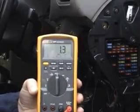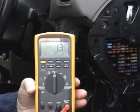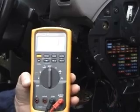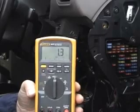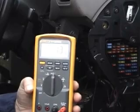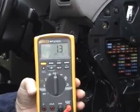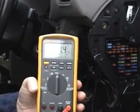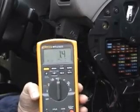Most probable causes for that would be any of the control units are internally damaged and we're putting that wire to ground. We could have water causing rot on the cables or causing a short. Or another common issue is on VAG group vehicles, the diagnostic line goes straight to any audio equipment, the stereo. So any aftermarket stereo fitted could interfere with that diagnostic line and could be giving us either a situation where you'll find 12 volts on the line, which would blow your kit, or it will put that wire to ground and we'll have no communication.